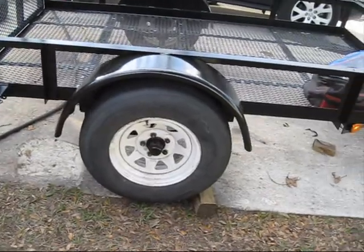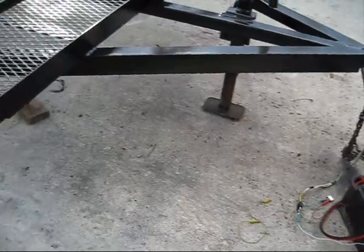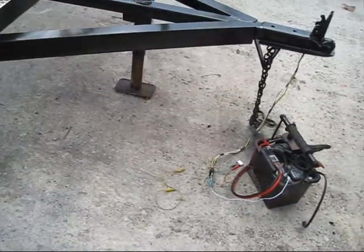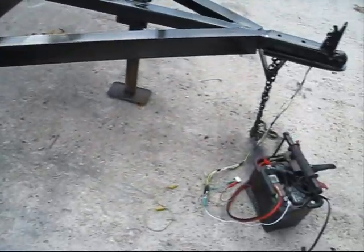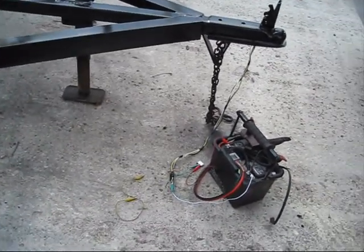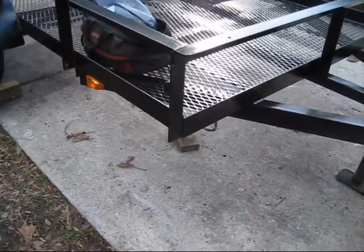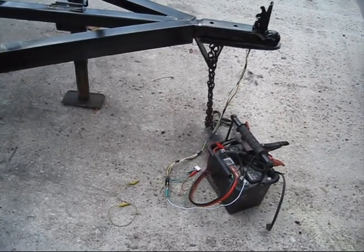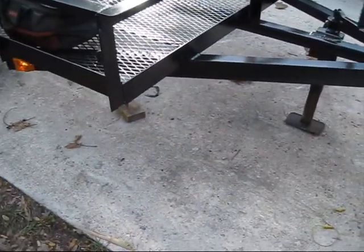This is really handy for a variety of reasons. You don't have to have the tow vehicle available to test your lights. You don't have to worry about figuring out a way to push down the brake pedal to check if the brake lights are working. And if you're troubleshooting, it allows you to provide constant power to any of the circuits while you're working on them. You can also use it to isolate the trailer from the tow vehicle — trailer lighting issues can be in the trailer or in the tow vehicle, but by using a battery you can eliminate the tow vehicle as the potential cause of your problems.